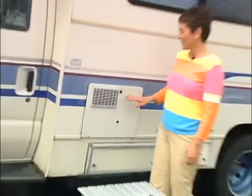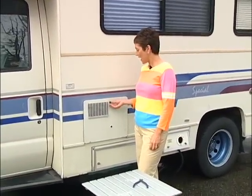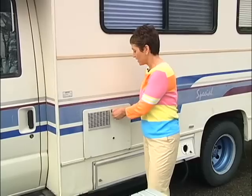Bonnie Moss from Livingston, Texas lost her entire water heater door in a desert windstorm. She thinks that the latch flipped sideways when they were washing the RV, so she recommends before going anywhere checking the latch to make sure it's facing down.